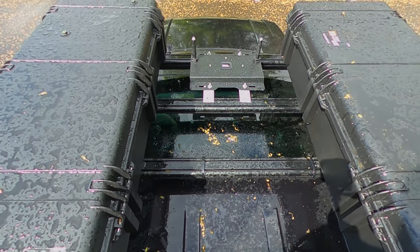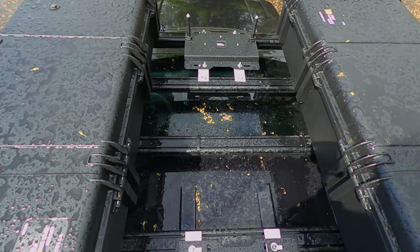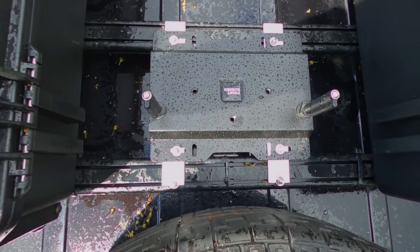So I found out, you know, I knew what the measurements were and I had the rooftop tent. With the Maxtraxs sitting on top of the Peli boxes, it just didn't look right to have these two red things sort of stuck up there. So what I did was I filled in the holes, plugged them, and then took the front runner Maxtraxs mounts. Because of the way the slats are on this and the spacing, I've had to get creative and put some 3mm aluminium, I think it's 40mm wide, flat bars drilled into where the slots line up and then mounted the Maxtraxs mounts to the bars that I have. So I've had to get creative on mounting it.